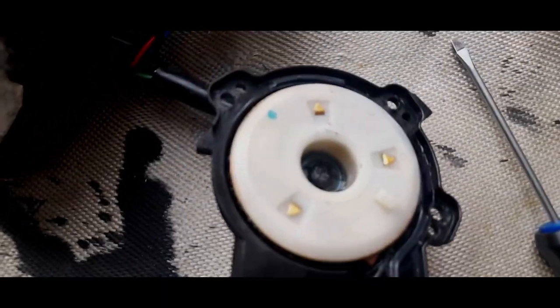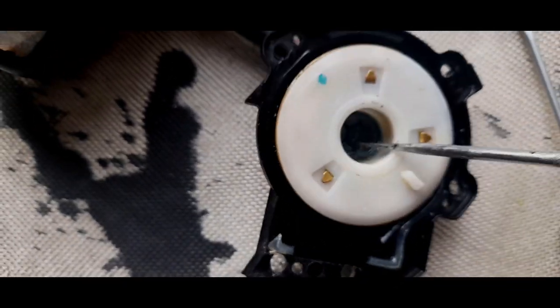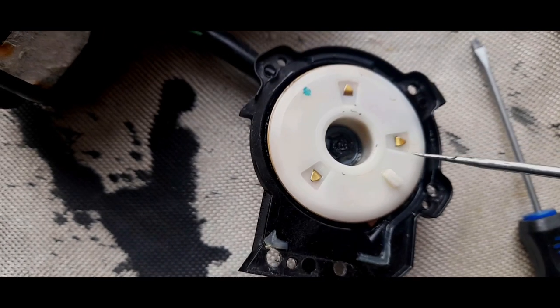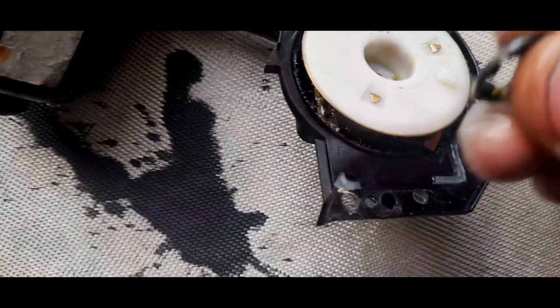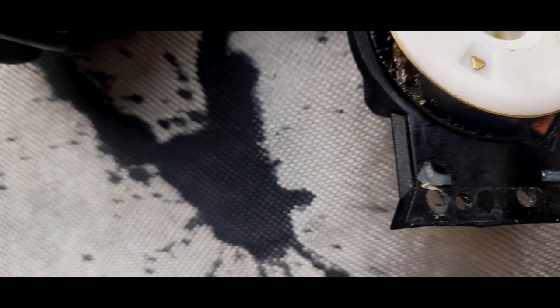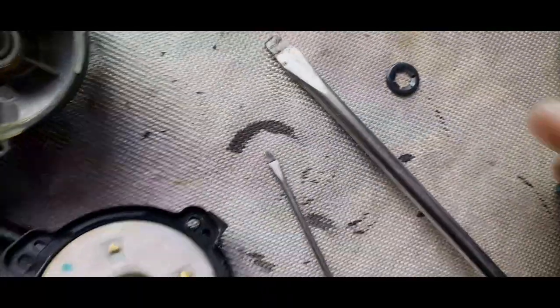Yeah, sorry, misinformation here. Basically, there's a little circlip in there, and what I would do is just lever it out with a pick. So just do it very, very carefully, and then this whole housing can come up. And it has literally come straight out, so... It looked like an 8mm nut with all that grease. It was quite deceptive, so just don't lose that circlip. So that's there, and this should just come straight off, and it has. Lovely.